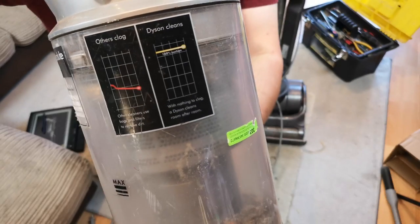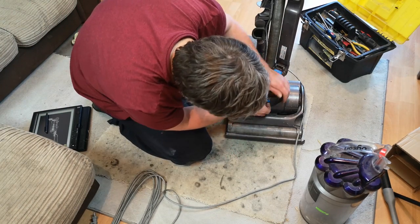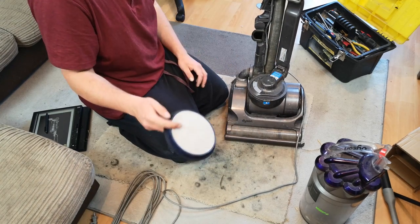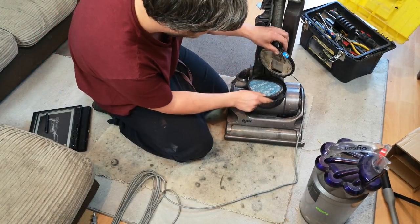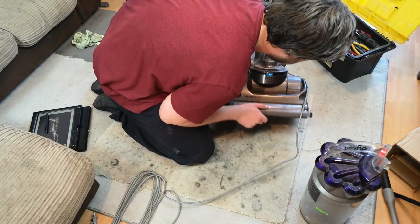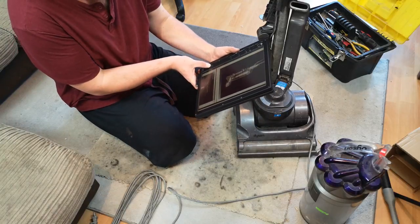This is the cyclone again. We didn't get that sticker on ours in the UK - Dyson DC17 Animal. I'm sure under here is where the filter is. It's not been loved, though the filter's quite clean. But knowing Mr. Tayab, I'd have at least given that a wash. It doesn't smell horrific but it's been in there a while. I don't know if there's a post-motor filter on these - I certainly cannot see one. We can have a look at the service manual.